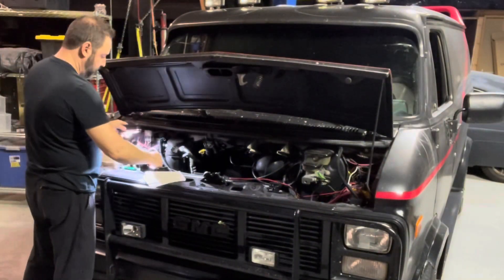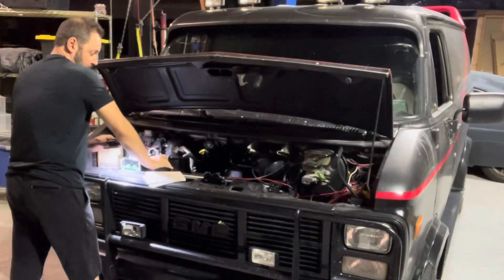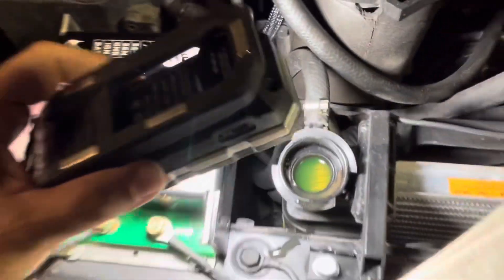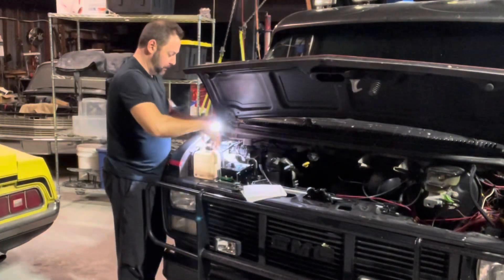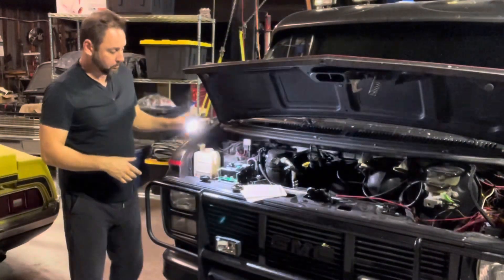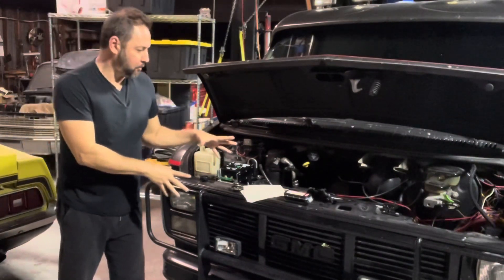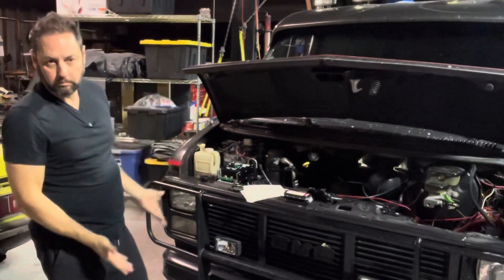We'll start easy — we'll start with the coolant, because it's important to keep things cool. It's full — it's so beautiful. Look how nice that looks. That's our new Camaro radiator and cooling fan setup that we set up. Let's see what we have in the old overflow. Hmm, it looks like it could use a little sip. Think about these LS engines — there's a crossover tube and it purges all the air from the top of the heads and takes all the air bubbles out of the system. So when you drain the coolant system or service anything, it's important to check your coolant after you run it a little bit and make sure that it's where it's supposed to be.